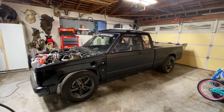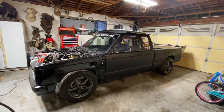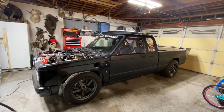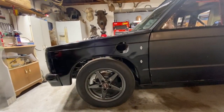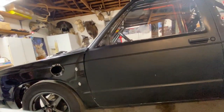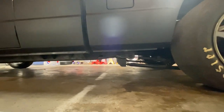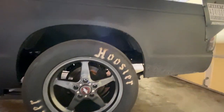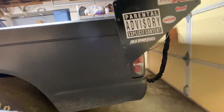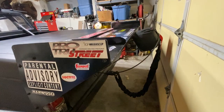I did have to get the harness from Holley to make my Holley Dominator to where I could run two O2 sensors at the same time. So I have two 450 pumps set up on this. That way, whatever boost setting I want, when the system sees the boost setting that I've got it set to, then the second one will kick on, so they're not both running at the same time. And again, that's on E85 with a little bit of nitrous.